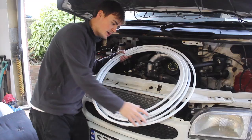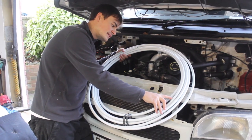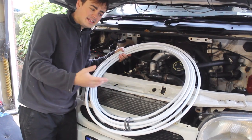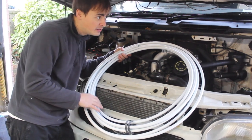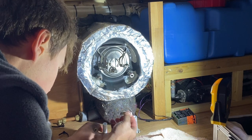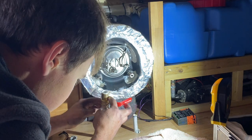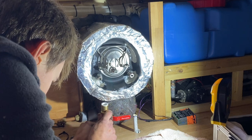Well done to the person in the comments who suggested my hose may pop off the copper pipe — you were right. Looking at the ratings: at 12 bar we can have 20 degrees, 4 bar at 82 degrees, and 3 bar at 92 degrees. Our engine coolant runs at about 80 degrees, so it should be fine. We've got plastic pipe coming through the floor now with a couple of pipe inserts, and proper push-fit isolation valves.